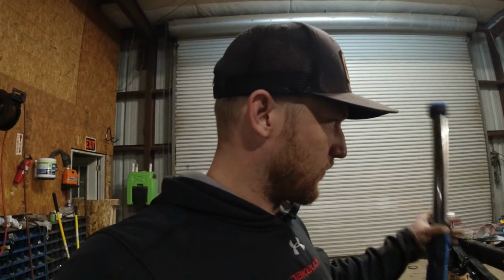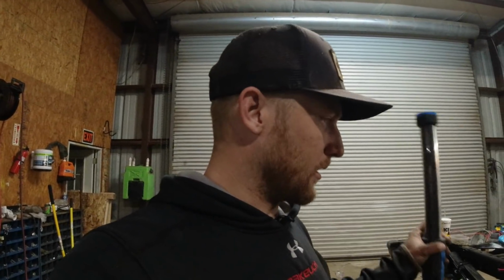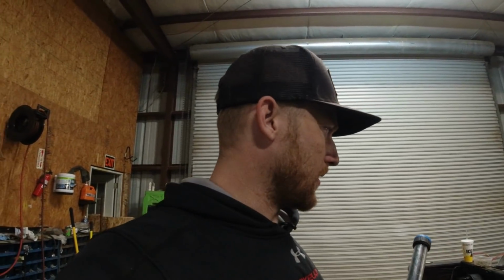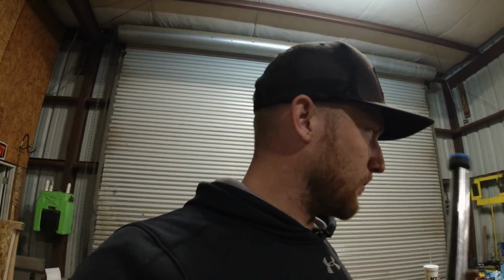Let that dry for a little while. I did a couple spots as a test subject area. So I'd do a spot fairly quickly. I mean, I let it dry for like 6-8 hours, and then I put the coating on it. I did 2 coats of the rust conversion over the top of it. You guys saw what that turned like after about 30 hours. It was like a dark purple. Then from there, I put another coat on it after like 20 minutes. That made it pretty solid. I could feel a layer of protection on the frame.